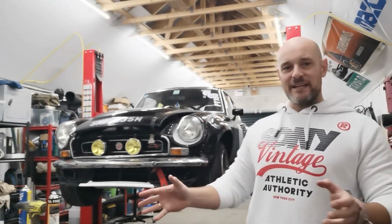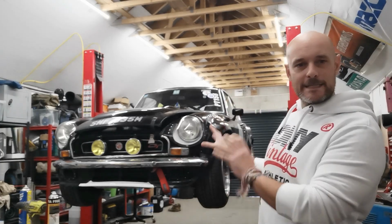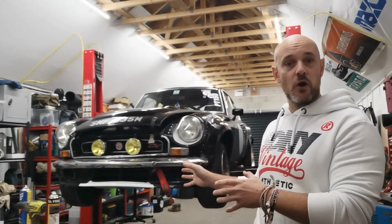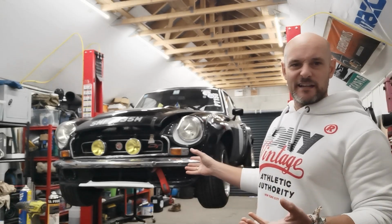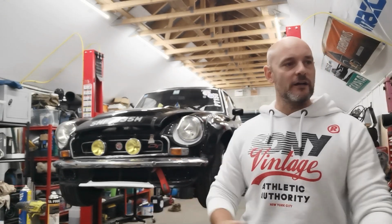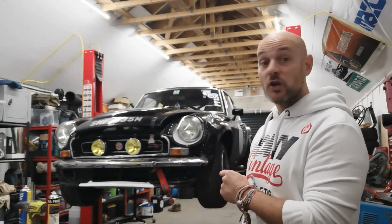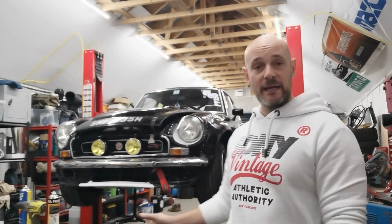Now, obviously, this is of a 1960s, probably 1950s design, really. So it uses cart springs. Not exactly great, and obviously a coilover setup is going to be better, but we're not going down that road at the moment, because they're expensive. So let's see whether we can make it on the cart springs, or leaf springs, wherever you are in the world, handle a bit better.